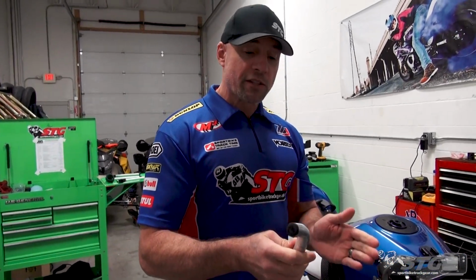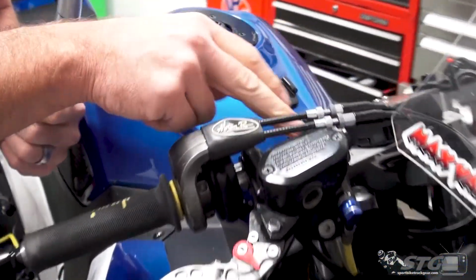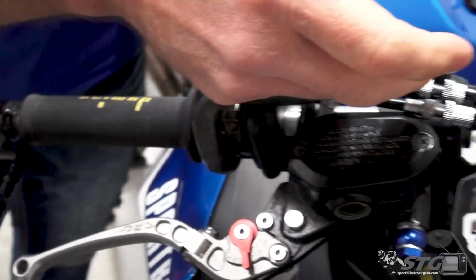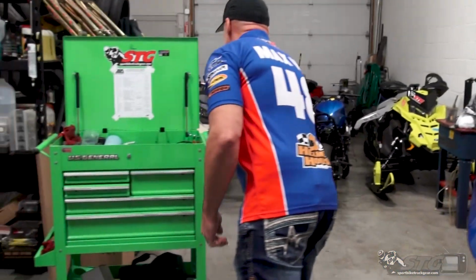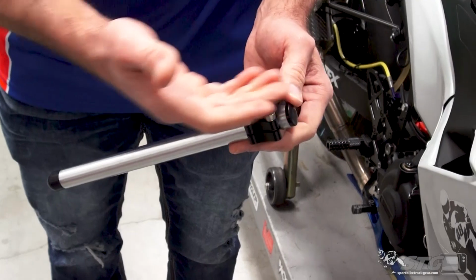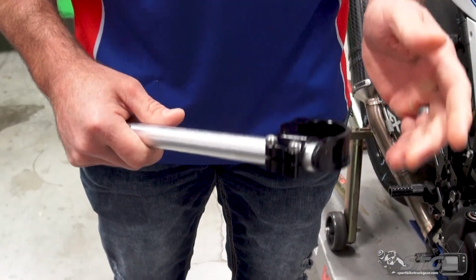It was really easy to repair that because when you have clip-ons on the bike, where they're two pieces, you have a cuff that's one piece and a bar that is another piece, all I had to do, plus the other repairs of course, was to loosen up the mount for the bar. Let me grab this, just give you a good example here. All you have to do is loosen these fasteners up and off that bar comes, okay? So it makes the repair much, much easier.